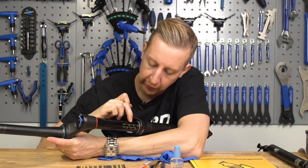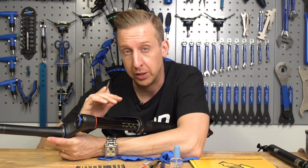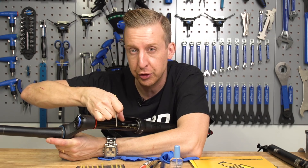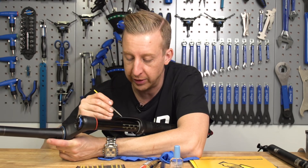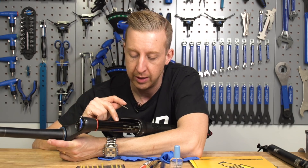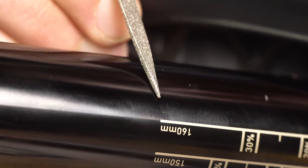There are two little nicks just taking out the stanchion tube on the right leg of the fork. I'm not sure when this happened, but it's annoying. The fork works perfectly well and I just want to make sure it stays that way. What you're looking for is to feel the actual sharp burr on the edge — that tends to happen when the metal on top just gets moved out of the way. What you're looking to do with your file is to just take the edge off the burr, but don't go too far, because you don't want to add any more scratching to the stanchion area.